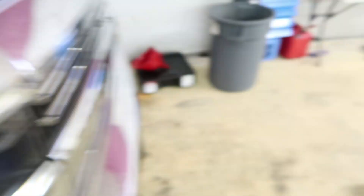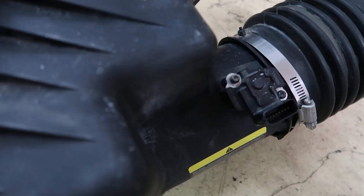You want the cushiony side down so it sits on top of that air box perfectly when the hood comes down. Next thing we've got to do is take the mass airflow sensor off the factory pipe and get it installed on this new pipe. You have the mass airflow sensor right here on the factory intake — take this off and put it right here on the Whirly pipe. I've got the torx head bit — not exactly sure what size, but it fits in there fine.